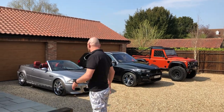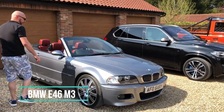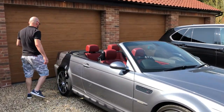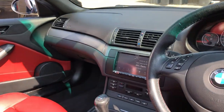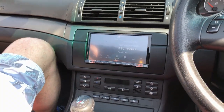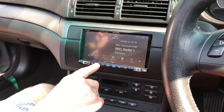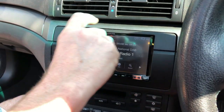The first demo car is the BMW E46. We love these — they're becoming a classic car now. We picked this one up a couple of years ago and we've done a huge amount to make it a nice little hi-fi car. In here we've used the Alpine ILX-E46-702. If you've done a bit of research into a double-DIN conversion on one of these cars, you'll see that one of the things you have to do is cut the airbox behind, because it's actually not a double-DIN space — it's a single-DIN space.